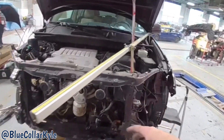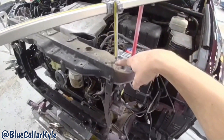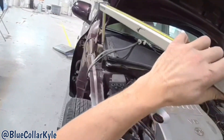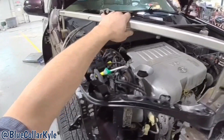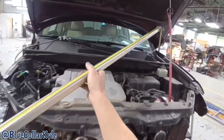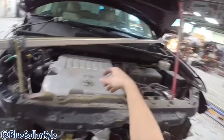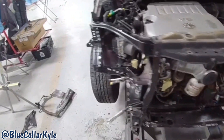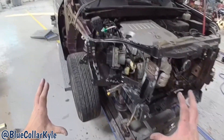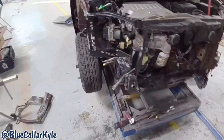I'm doing comparison measurements — checking the length from a hole in the back to this front point, then comparing it to this side. It's pretty close. Then doing an X measurement from corner to corner and that looks just about perfect as well. I want to fit up the new fender and headlight to make sure this bracket is sitting exactly where it's supposed to and everything in this corner is fitting correctly — but it should be very close.